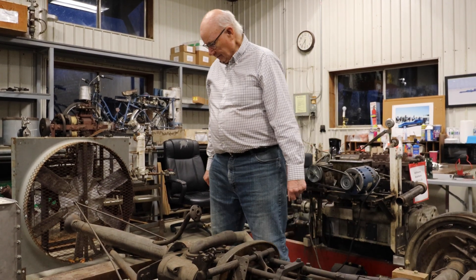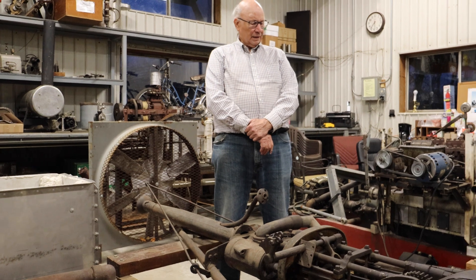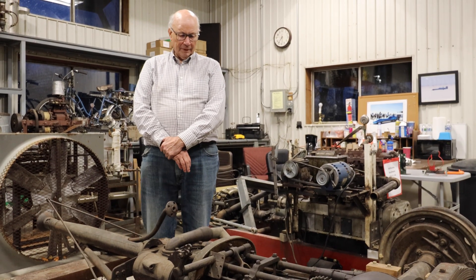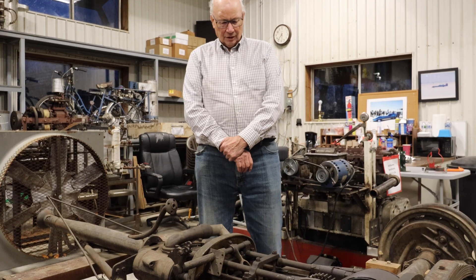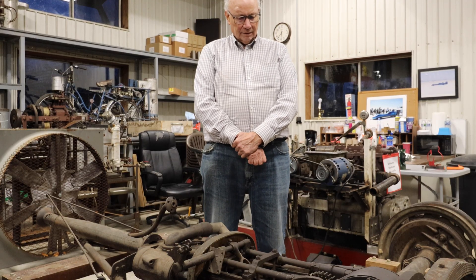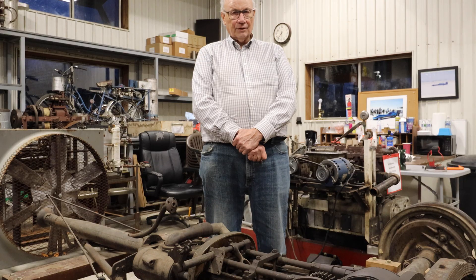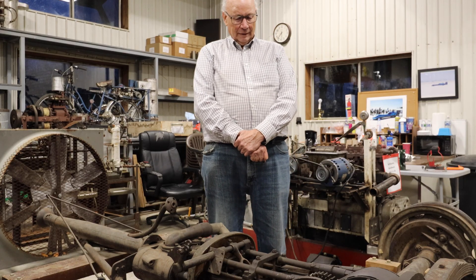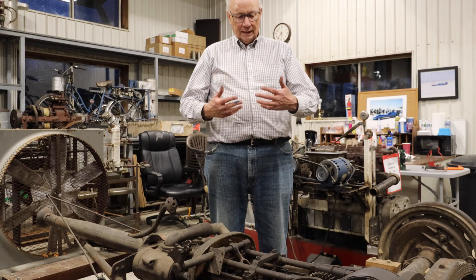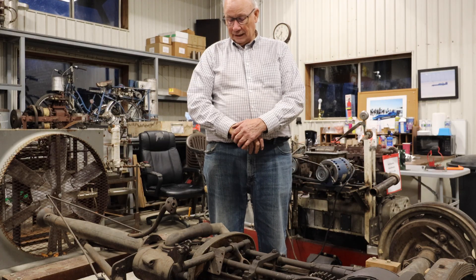It was a good idea at the time. When Stanley made their first car, gasoline engines had barely been invented, barely worked, and were not perfected. One of their big problems was getting a facing for the clutch, so this design avoids the clutch. Back then you did not have synchronizer gears, so the gearbox used straight-cut gears — not easy to shift. You had to double-clutch and hit things just right, or there was an enormous grinding of gears. It was thought at the time that women were unable to figure out how to shift gears and do the double-clutching.